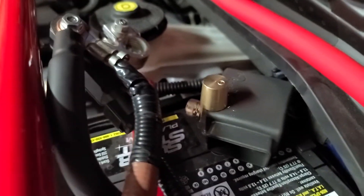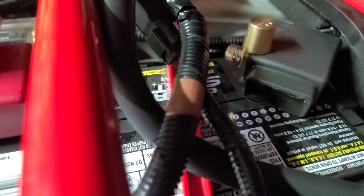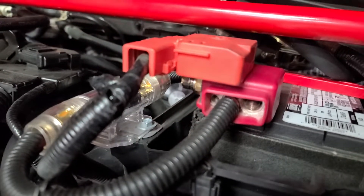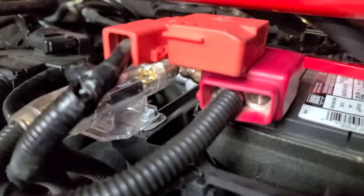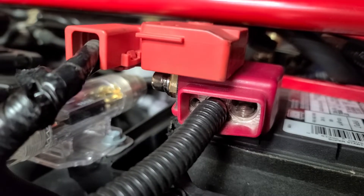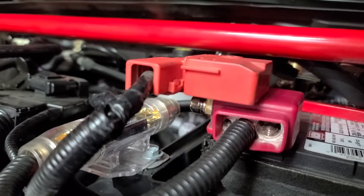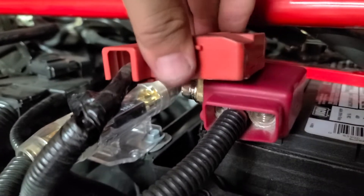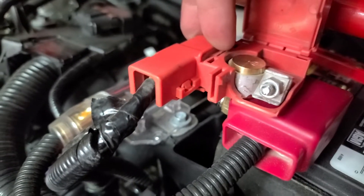I also did the vertical side post adapter on the New Concepts ultimate battery connector — I really like these. They allow you to add accessories to a car like this and keep your factory harness. I first saw this on Mark's Fab Kitchen car audio fabrication, and I thank him because these things are not that much money and they reduce a lot of headaches.